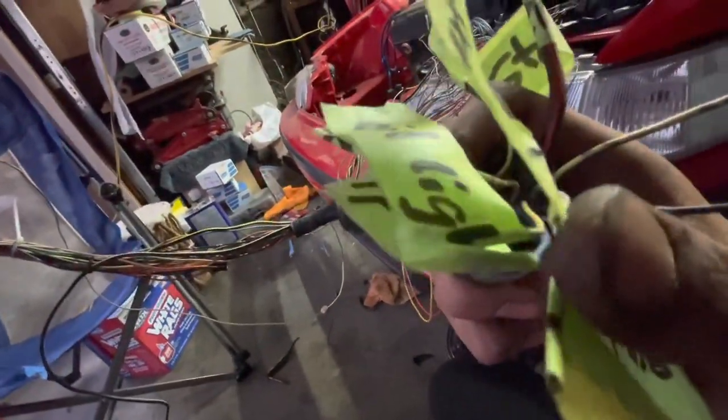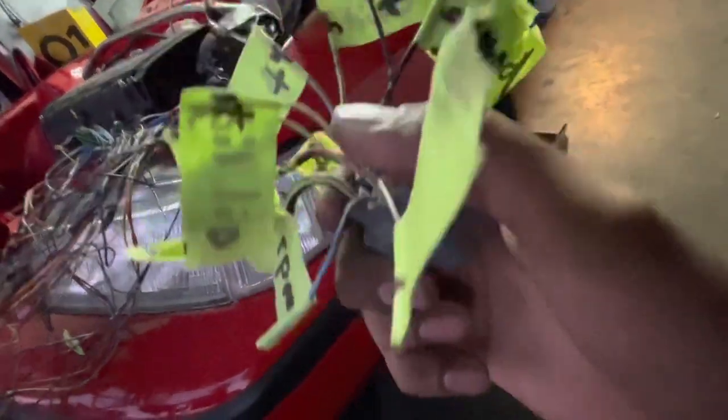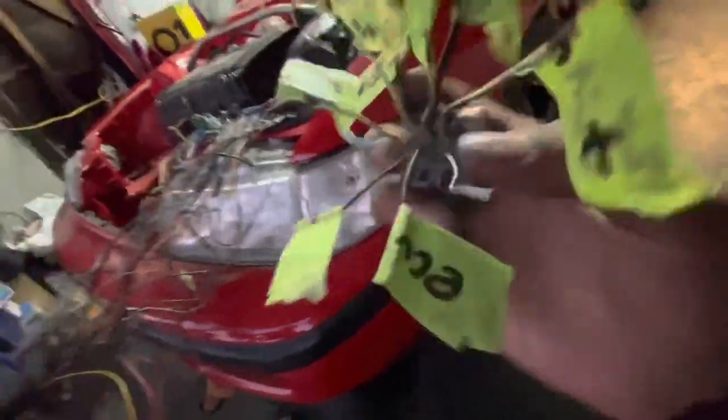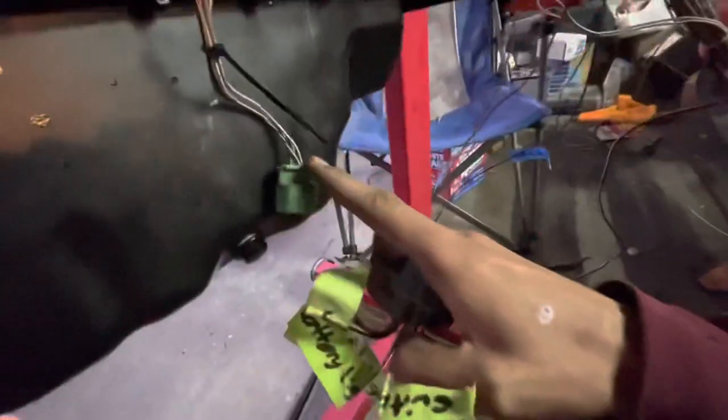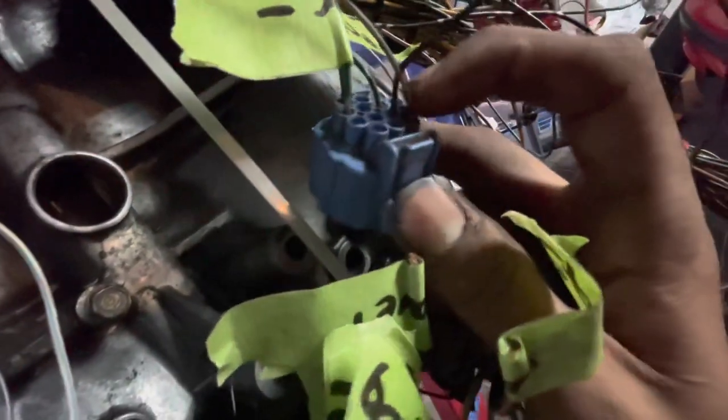The next wires are warning lights: the grayish-white wire is your battery warning light; the yellow/red wire is your oil warning light, coming straight from the oil sender; the yellow/green wire is your cluster temperature, coming straight from the temp sensor. Then your tachometer wire carries RPM signal coming straight from your distributor. The brown/black wire is logic ground, and the regular black wire is your ECU analog ground.